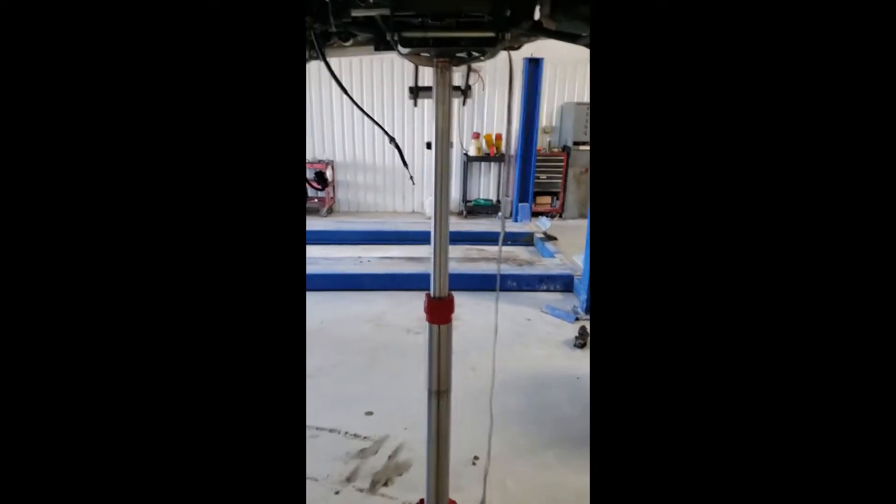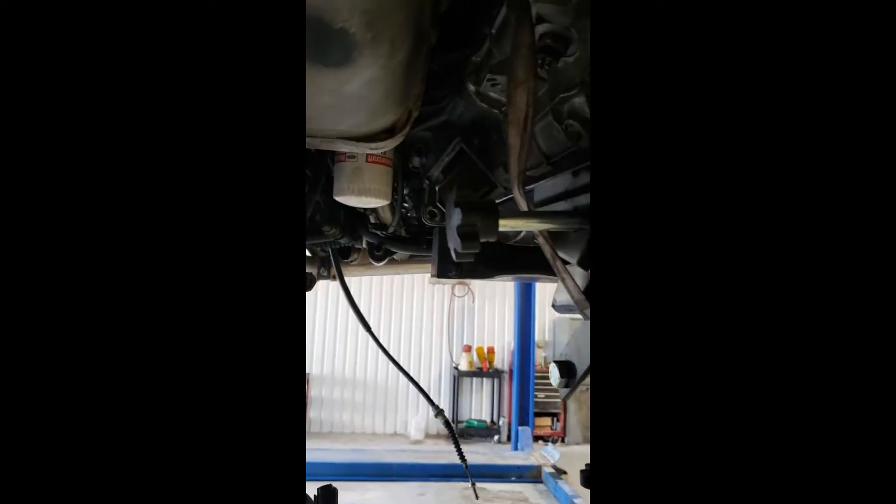I have the transmission brace out; it's secured to the transmission jack now. If I just lower this down a little bit — you can see the gap up there is getting bigger and bigger. That's about all you're gonna get — just a few inches. If you didn't drain your transmission you might want to — I'm going to put a glove over this and zip tie it to catch the tranny fluid. As you can tell, you have a few more inches up there — that's what you need to get to those top two bolts.